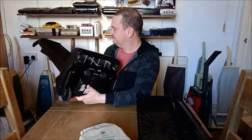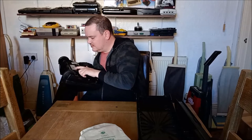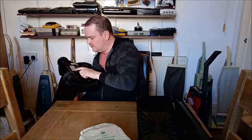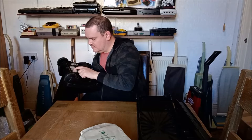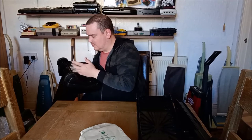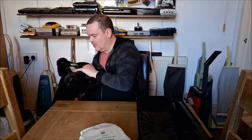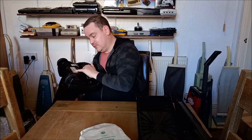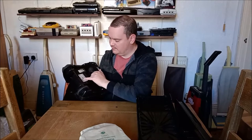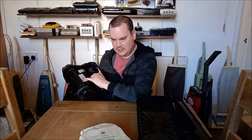But yeah, this is an American style serial number. If I read this out to you, it's a C1417-903, 230 volts, and the serial number is 06000001205 6. So that's the 12,056th machine made at whatever time this was. I suppose we could say it's a 2000, because that would make sense, wouldn't it? If it was a 6, if it was 0. So if we put the model number in front, 141706, so that could be June 2000.